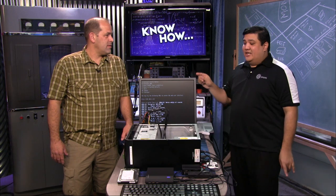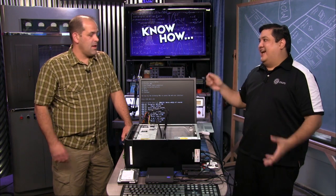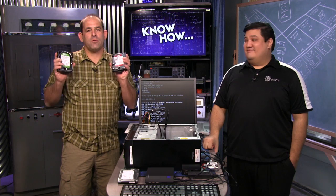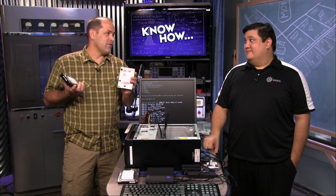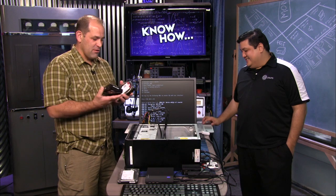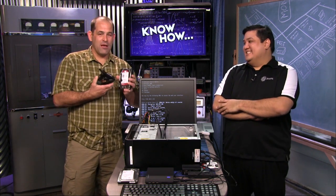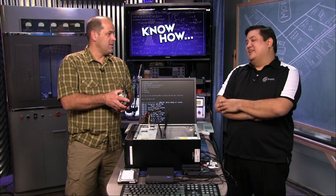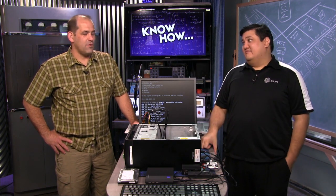One quick thing before we go: a lot of people will be tempted to grab any drive they can from the basement and drop it into the box. If you're doing it as an experiment, feel free to use any junk drive. But if you want to be serious about a NAS configuration, go straight to Western Digital Red drives. I run a lot of greens because I bought them before reds existed, and drives are expensive. As I replace them I'm buying WD Reds. I have 32 greens. Reds are better because they run cooler, use less power, and will survive longer inside a NAS array environment.